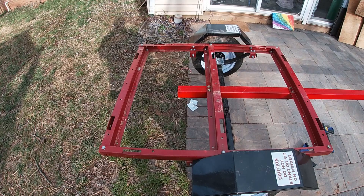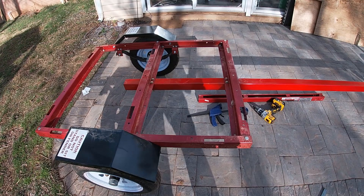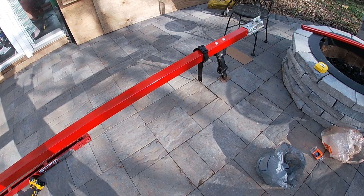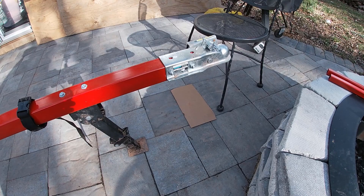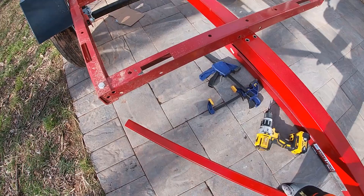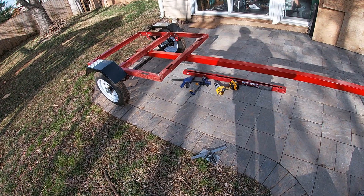All fixed — I took it off, flipped it around, and drilled two more holes. There are two ugly holes I'll paint over, and I'm going to tell myself I'll get plugs for them too. Got the support and hitch receiver back on. The next thing I want to do is add these one-inch square tubes, about three feet long, bolted at an angle to provide a little more lateral support since this tongue is so much longer. I've got some more holes to drill and a piece of steel plate to cut for that.